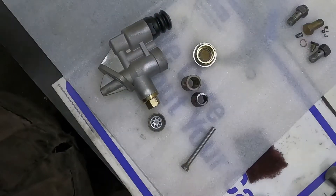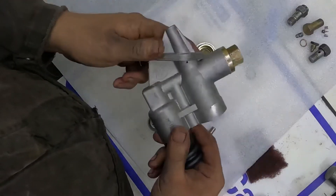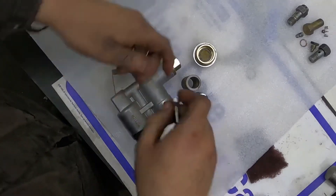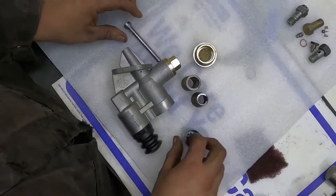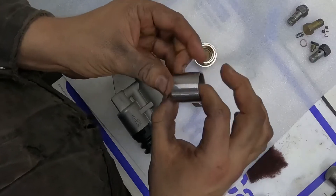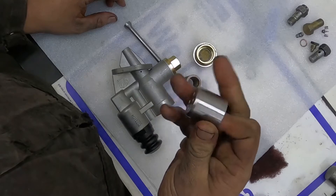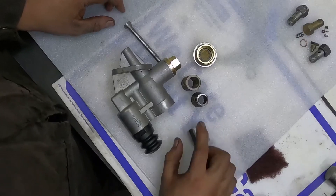This is a factory style lift pump for a 12 valve — this is a brand new one because I do it to brand new ones for guys. Whenever we put one on, if it's a hot-rodded truck, we'll always upgrade this. This is the plunger — it touches the camshaft and moves in and out by the lobe on the camshaft. Not all pumps are equal. This is a 30mm plunger, and if you're doing one, you prefer to do it to a 30mm. Now, if you have an older pump or some aftermarket or cheap pumps, they'll have a 26mm plunger in them.